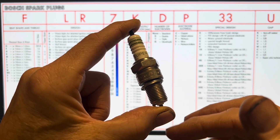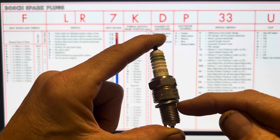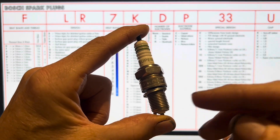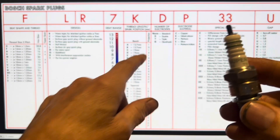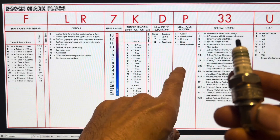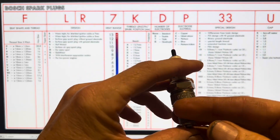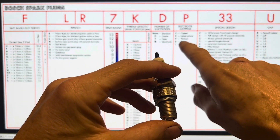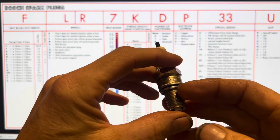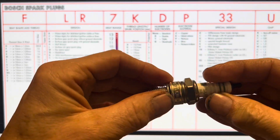Equally, if the threads aren't long enough, the spark fires in the wrong place and doesn't cause combustion at the right time. The 'C' in the Bosch spark plug code means it's a standard spark plug — often called a copper plug, although the electrodes are made from a nickel alloy, not copper. A 'P' or 'I' in that position would indicate platinum or platinum-iridium. The final zero means it's a standard design.